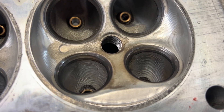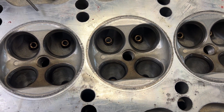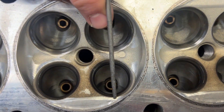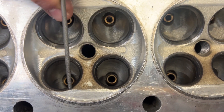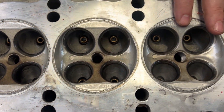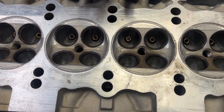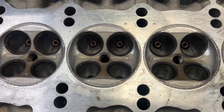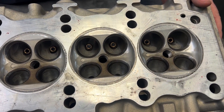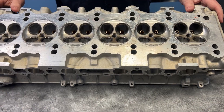That's very normal. But the combustion chamber looks great — it's been spray washed and ultrasonic, and it looks really, really good. I don't really see much going on except for this cylinder here. The valve seat on the corner looks like it's getting a little hurt, burning up a little bit. I don't know if this is the cylinder that got hit, but none of these actually look like they have damage from a rod coming through. Part of that is because we put good valves in it — valves are not going to break, so you don't have catastrophic failures. You'll also notice there are no water jackets, because the car goes over 200 miles per hour in a quarter mile, and the last thing you want is to drive over your water at 200 miles an hour.